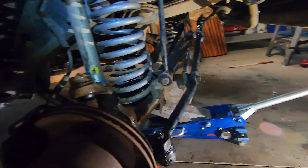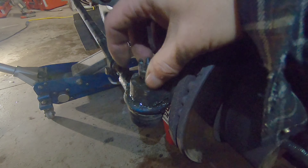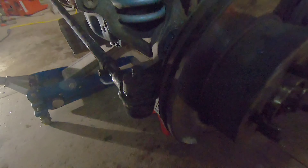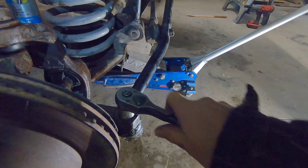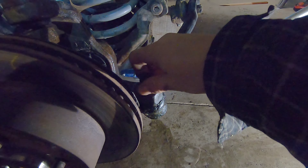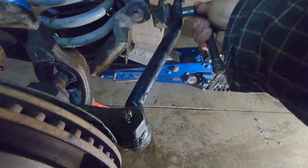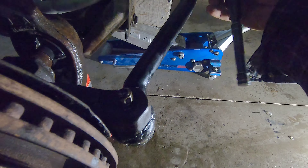Lots of pins to take out. I think this crossover steering actually eliminates the stabilizer, but I know there's a bracket I can get to mount it, so we'll see how far we get. Stock parts — get rid of stock parts. Basically you have to remove all these ball joint ends. Now the spindles have to be drilled out to 5/8 for the new heim joints for the crossover. We just replaced these not too long ago and they wear out so quick. The Jeep has been lifted like 4 inches — these are all stock parts and this is how it was when I bought it.